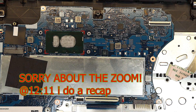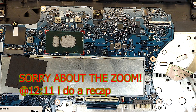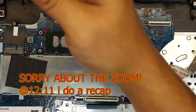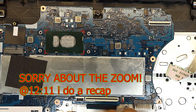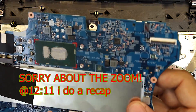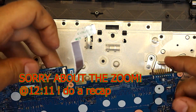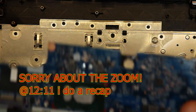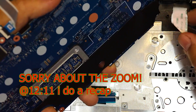To remove the motherboard there are a few screws to remove — one over there, one over there, one there, one over there, and one right over there. Once you remove the screws, lift up the motherboard. Remember, this cable has tape too so remove the cable from here. There's also a cable that got loose from underneath — it's this one right here underneath.